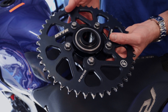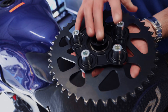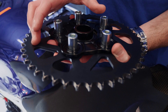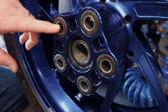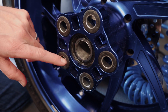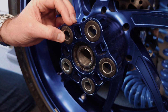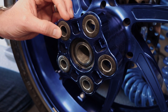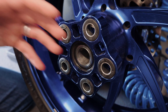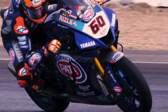This is the last part of the drivetrain — the rear sprocket, which is mounted to the sprocket carrier, because we don't want to mount the sprocket directly to the rear wheel. What you can see here is the Cush Drive inserts. These five rubber inserts, which have a life of 700 kilometres, are basically a cushioning system for the sprocket carrier to protect the front sprocket, the rear sprocket, and the chain from the reaction during opening and closing the throttle.